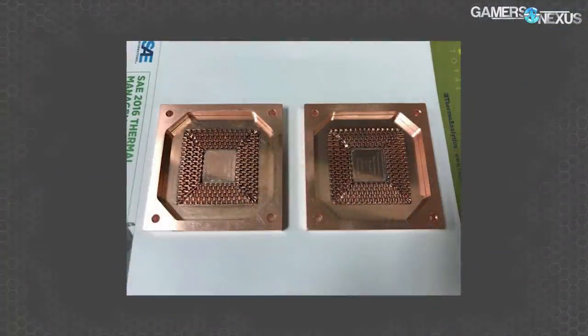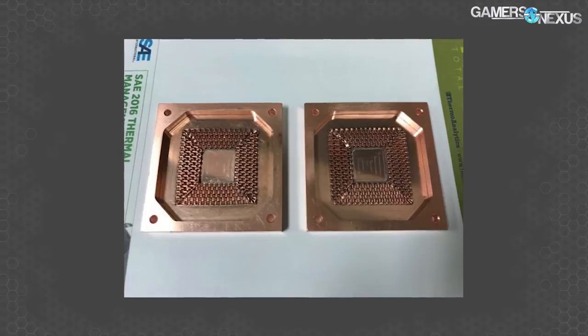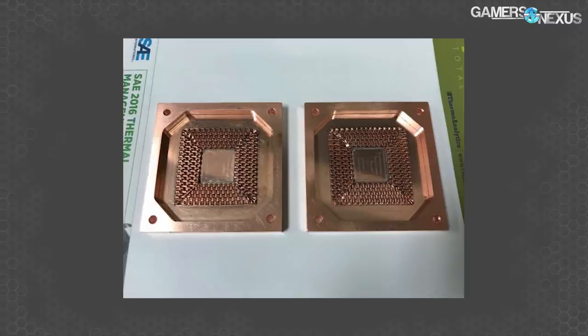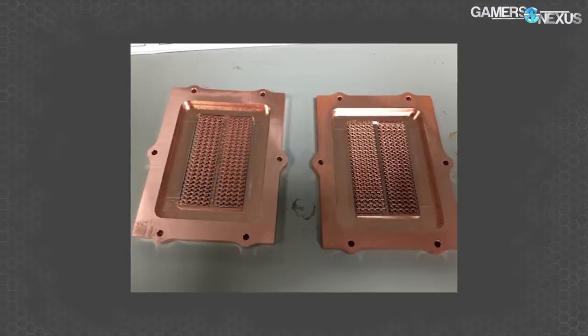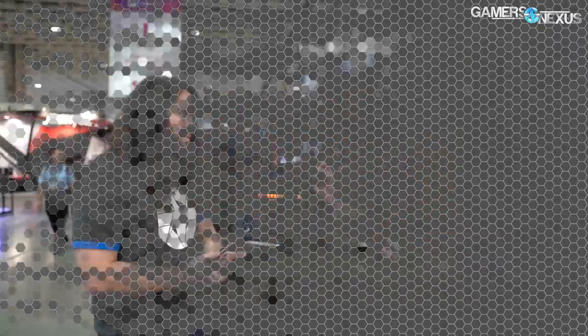You also showed me a photo of the inside of the cold plate — a Threadripper one, I think — and there were fins of varying heights. The symmetrical parallel fin arrangement is not efficient. The best way of cooling is to create a vortex or real turbulence in the water. So we have what we call an offset strip fin arrangement — varying heights of fins in a pattern, but very much randomized to create this turbulence — focused around keeping pressure and improving performance.